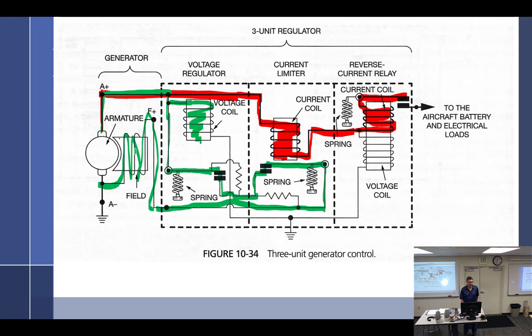That 2 volts is going to energize this coil, which is going to give it a few more volts. The few more volts is going to go around, and it's going to bootstrap itself. There's a word we have to start using. Bootstrap itself until this thing is putting out more voltage. Let's say 14 volts.